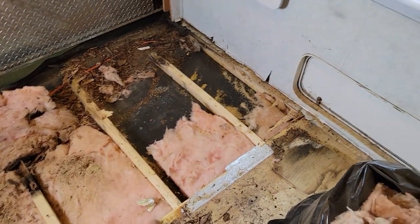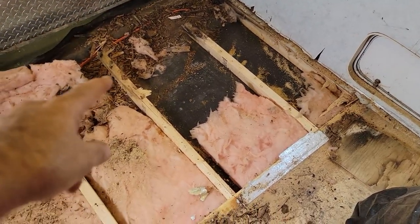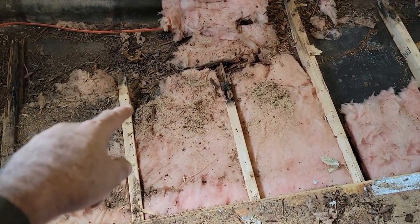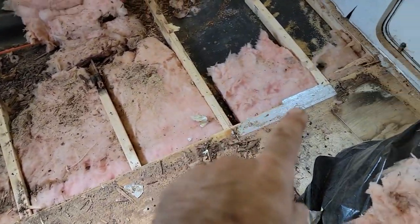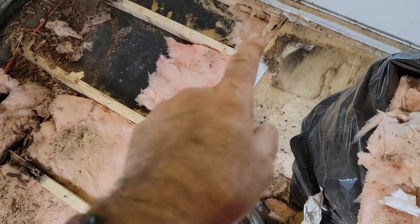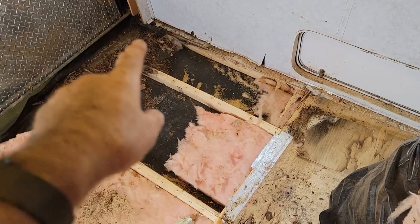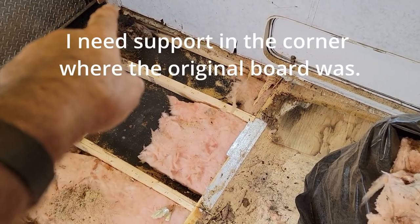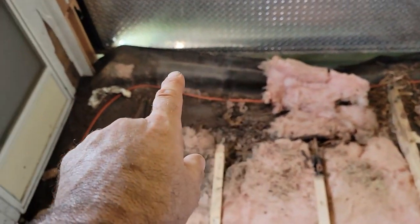We're going to take a look at the damage now. We've got the plywood off. We can see just that part of that board back there is bad — from here forward is gone. This one right about here is good, this one right around in here is good back to there. What I'm thinking I might do is, once I repair this over here, put another board alongside it for extra support and not try to take all this up underneath. I'll take out what's bad down here where it bolts down to the frame.